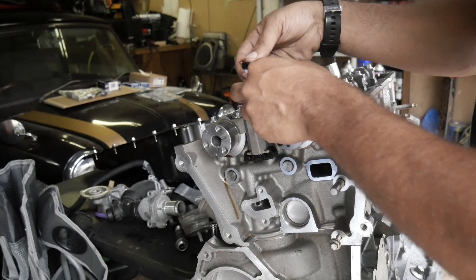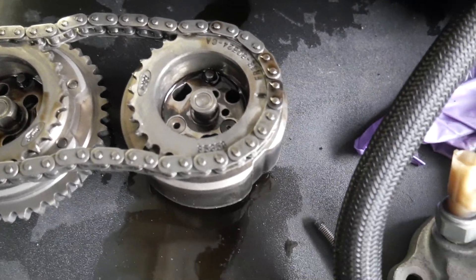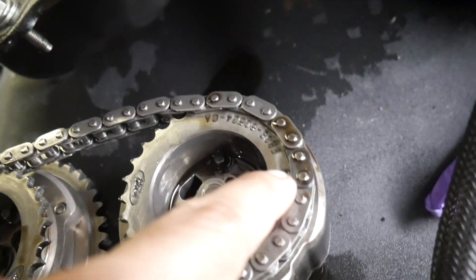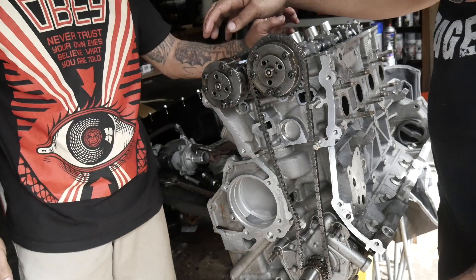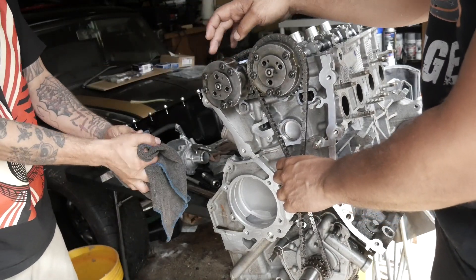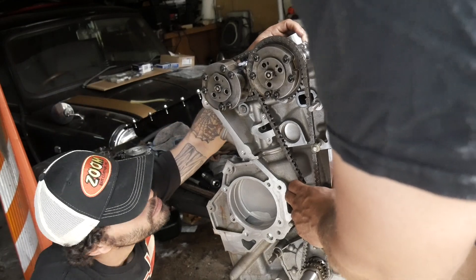As we get ready to put everything in together, on the intake side we have one chain link that's darker than the rest — that's going to line up right there. Over here on the exhaust side we have a hash mark that's going to line up in between the two darker colored links — that's how you know to set this chain up. Drew and I are having trouble lining up the intake side, so Drew came up with the idea of marking here on the gear and also here on the camshaft to line it up. We tried moving it with a wrench but couldn't get where we needed, so we put the timing chain back on and are slowly turning it using the pressure to line everything up. There we go. Sweet!